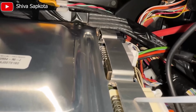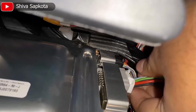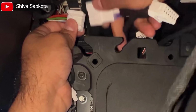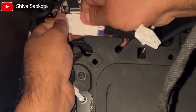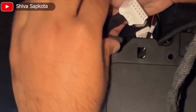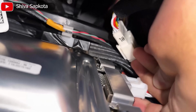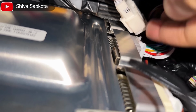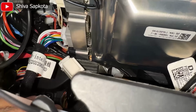This is the difficult plug we need to remove for the cars with an Intel chip. You just have to pinch on the middle tab, and while holding it down, pull the plug out. Then take the new harness and plug the male Tesla adapter into the female adapter of the new harness, and then take the new male adapter and plug it into the Tesla computer. Make sure to align the plug straight to prevent bending Tesla pins. Again, this is super tedious and requires a lot of patience. At the end, it should make a complete circuit.